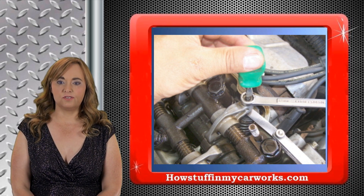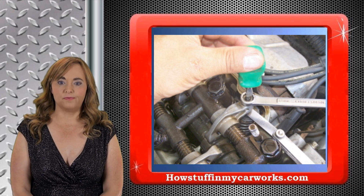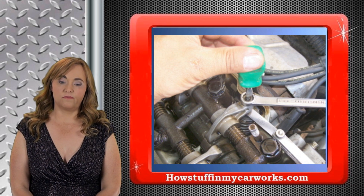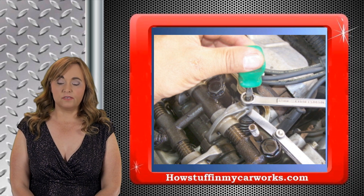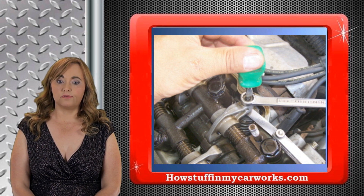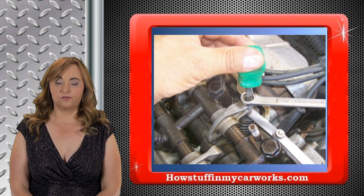The way we did it, as you can see in the picture, we made sure that the opposite valve was open. In the picture, the intake valve is shown open, to ensure that the valve we are adjusting — which is the exhaust valve shown in the image — is completely closed. After we adjusted the exhaust valve, we rotated the engine until the exhaust valve was in the open position to adjust the intake valve. We did this on all four cylinders.